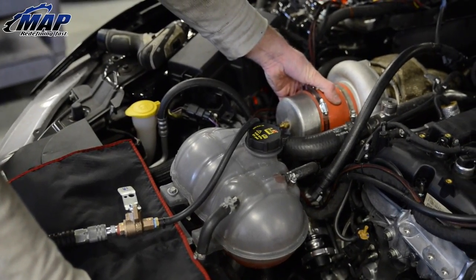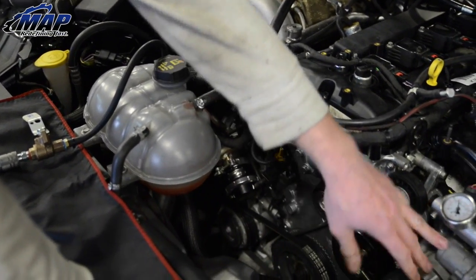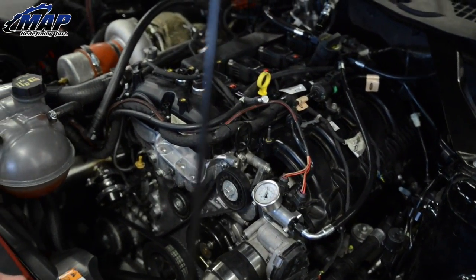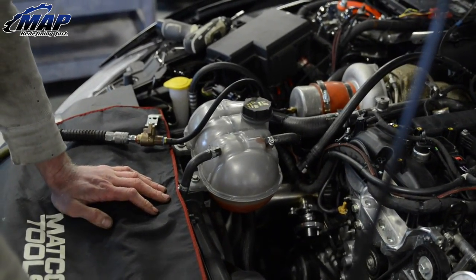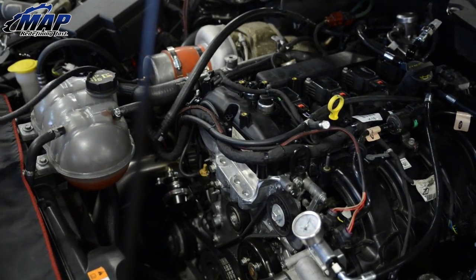As you can see, the coupler is starting to expand, so you know it's got good air supply. Then what you want to do is follow all the way from your intercooler piping, throttle body, and check through your intake manifold. Make sure you can't feel any leaks. It also helps when all of your air fittings are nice and tight and not leaking. By doing it this way, you'll hear a hissing noise, and then just check for leaks.